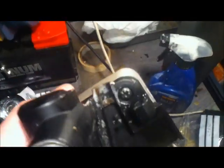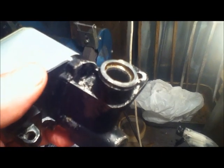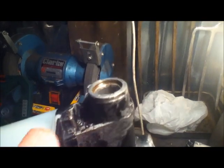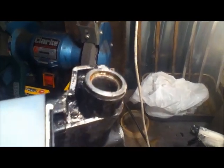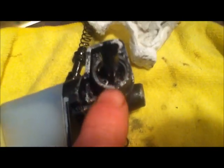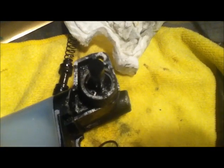I put the reservoir back on with the new seal — a tiny bit of oil on it and it just pushed in easily, and the screw went back in. That was a very simple job. When I took the circlip out I noticed red grease in the groove, so I've dug out all the old dirty grease and I'm putting in a little bit of bicycle grease. I wound the assembly in with a bit of oil, held it with my thumb, and the new circlip went straight in. These new circlips are handed — there's a flat face and a round face — whereas the old one was flat on both sides. Probably could have reused it, but it was a bit rusty.